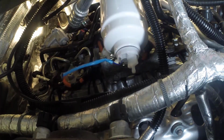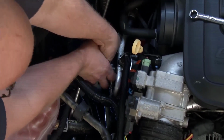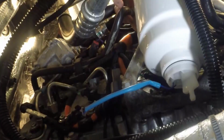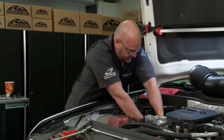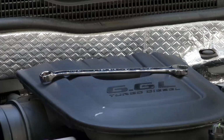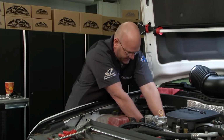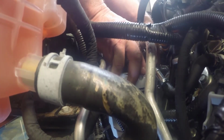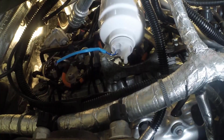I'm just going to take one bolt and go finger tight to kind of hang it in space there, so that I can reconnect those fuel lines. The fuel lines, you don't want any leaks. You got to get those clamps seated right. And again, access, biggest challenge. Not all that complex. And of course, you see that open end wrench laying there? That's the only thing that works in this tight space, is one flat at a time. So take your time, get it right, and then I'm going to begin the process of reconnecting the fuel lines.